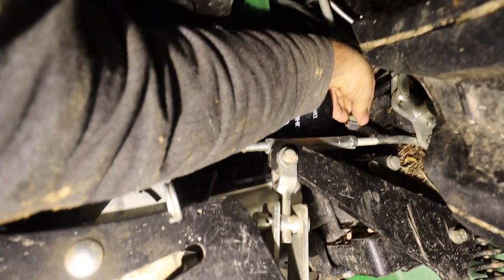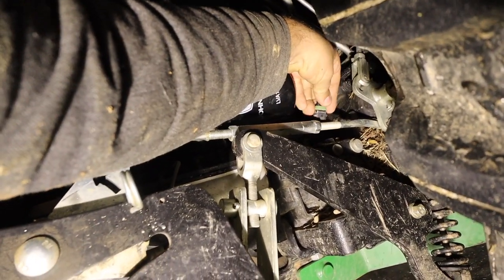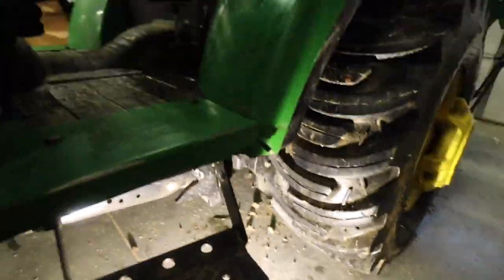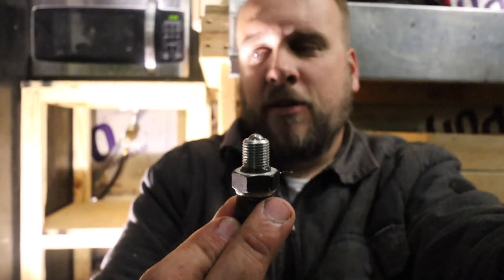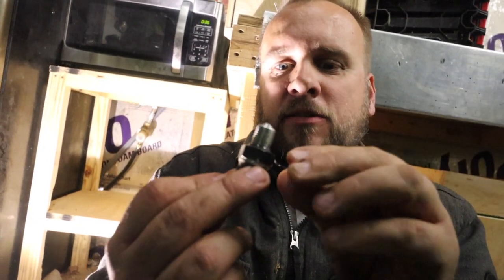Here's the plug, and the retaining clip wasn't very firmly seated on the plug. I'm going to see if I can get that pulled out. I definitely won't be able to get a camera angle on removing that, but I'm going to go ahead and switch that safety switch out. That was not especially hard to get out. It'd be a lot easier to reach if you had that wheel off, but I've got wheel weights and fluid in the tires — it'd be too heavy.